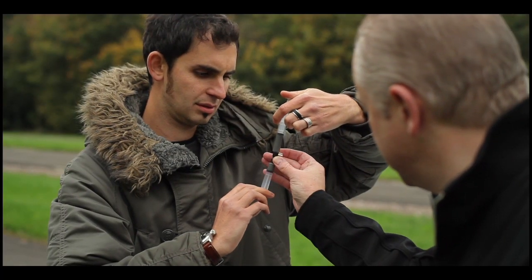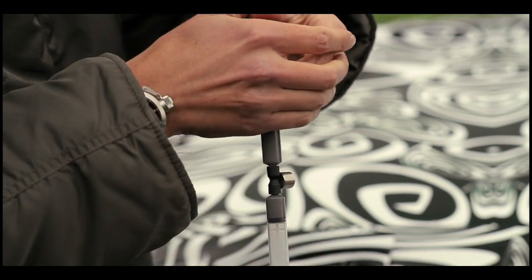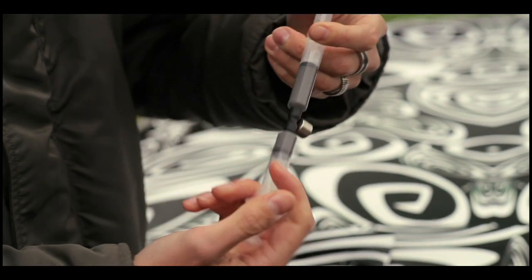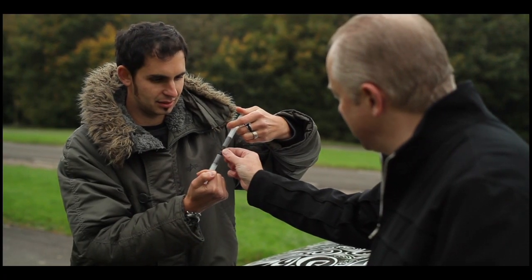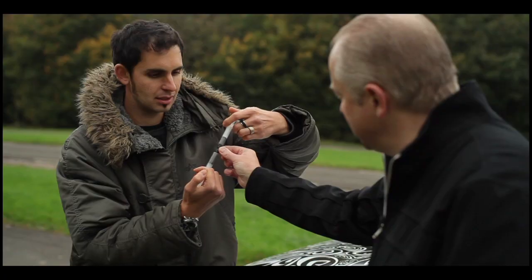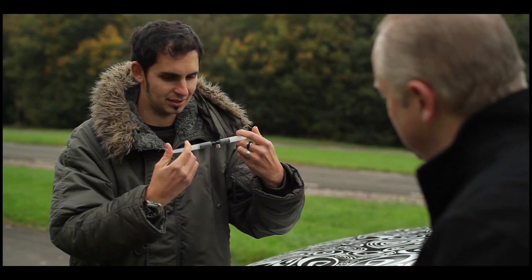Now let's see whether you need to go and work out a bit more. Crikey, it's just locked it straight up. So that's probably the most extreme version. Normally we just vary the current, but here we just vary the distance away — and that's probably more like how you'd like your Range Rover, a little bit on the sporty side, but still some plushness and comfort there. That's incredible, it locks absolutely solid. And if you go into dynamic mode then obviously we can increase that current — a bespoke tune just for that situation.